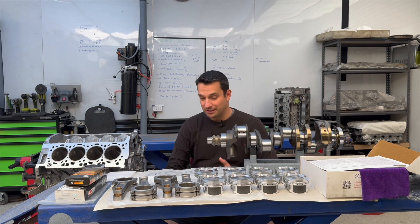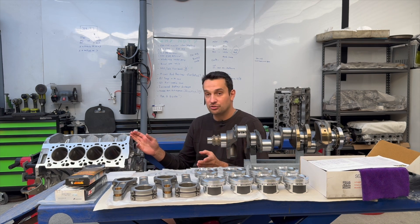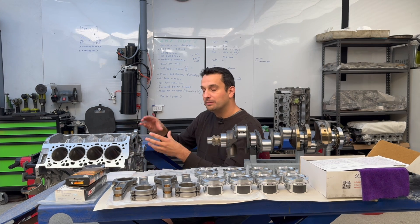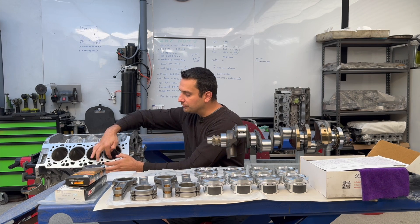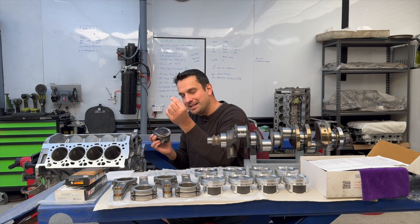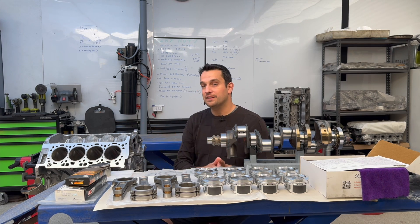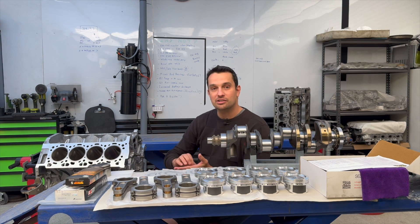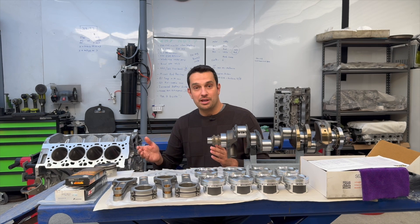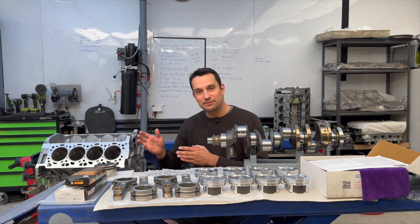Talking about the S63 block — and not just the S63 but most BMW and Porsche engines — they're made of a compound called Alusil, which is a mixture of aluminum and silicon. The way the liners are finished at the factory is using special machinery that removes the aluminum from the surface, leaving just the silicon. So your stock BMW pistons and rings are actually riding on a thin layer of silicon rather than touching the aluminum itself — that's why they last so long. The downside is whenever cylinder walls get scratched or worn too much to use stock pistons, the block is considered garbage and people say you have to throw it away and buy a new one.